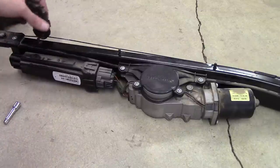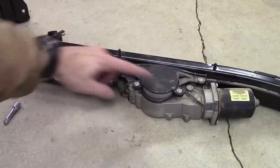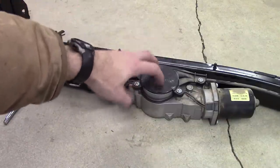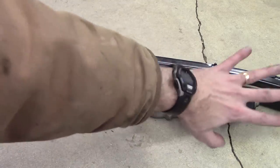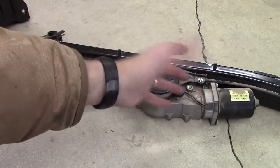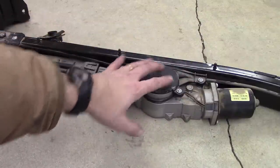So like I said, there's this plastic cabling that comes through these sheaths here, and it's all wound up in there. I definitely want to pop that open. We'll do that in a second. And then I actually might just pull the motor off, make sure it's spinning freely in both directions. Something's getting gummed up there. So why don't I do that?